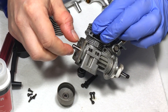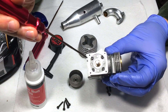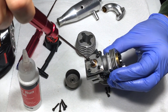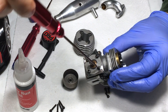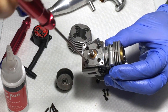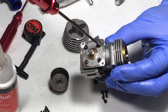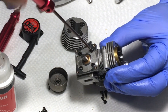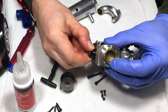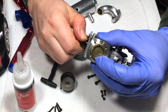I've put all four screws in — they're not super tight yet. When you want to really secure it, use an X-pattern. This distributes force evenly so you don't squish, break, or destroy the gasket or any metal components — especially if anything is slightly crooked.